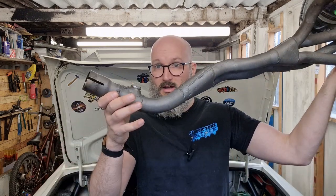The last sensor is the lambda sensor, which goes in the exhaust after all cylinders have joined together. On the Cortina's 4-2-1 exhaust it goes right in there — I actually welded one in over winter hoping to do some carb tuning. It measures the oxygen content in the exhaust to determine whether the engine is running rich or lean. There's going to be quite a bit of wiring involved, but I've got an idea on that which I'll cover in a couple of months when I get around to it.